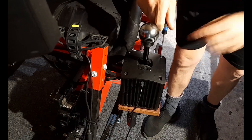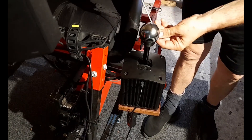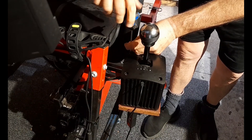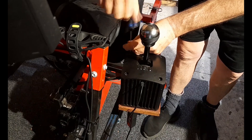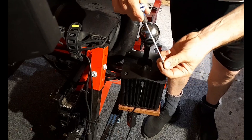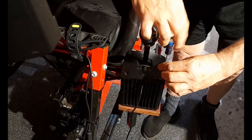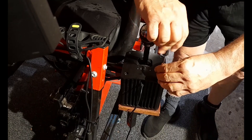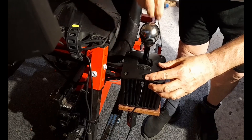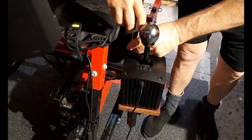And it is as simple as that. If you don't have soldering skills, you might need to get someone to help you. It would be a big advantage to solder this rather than just putting the wires in without soldering — they will fatigue earlier and you'll have shifting problems again and have to go through this whole process again. Crimping ring terminals is not that hard. I've got videos on my channel for doing that in my motion simulator build tutorials.